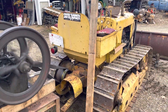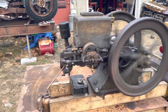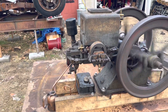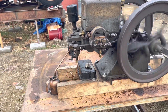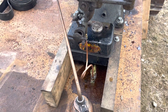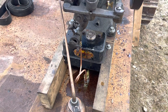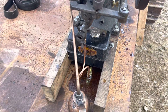I had to belt it up to the bulldozer today and run it and start it on a balance. But there's still a big issue with the fuel system. It's got good compression now, but it really starves for fuel. The horizontal check valve that's in this thing — that's got to be all redone, because it doesn't have the ability to pull that ball off its seat. I'm not quite sure what's in there, but we need to make a simpler arrangement.